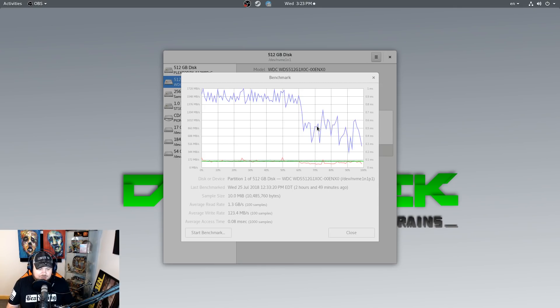Let me tell you the troubleshooting steps I've taken. I installed the drive and set it to PCIe x4 in the BIOS. There is no generation change to Gen 3 option within the MSI X470 Pro Carbon gaming board, but I did upgrade to the latest BIOS. None of that seemed to change the speed. Currently what you're seeing is the speed results in the 2.0 slot — there are two M.2s on this motherboard, the first is PCIe 3.0 and the second is 2.0. I planned for this one to be in the 2.0 slot knowing I'd get a little less performance, but didn't expect this kind of result.